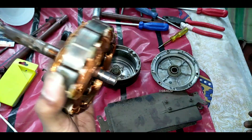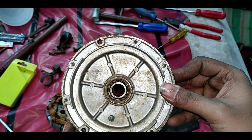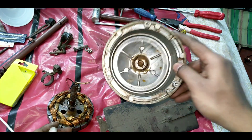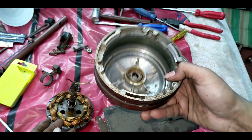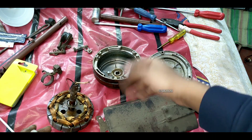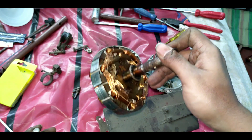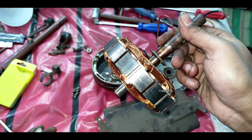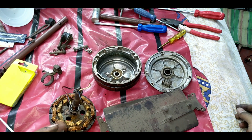This is an 8-pole winding, and the bearings are also somewhat greased previously. There is a bearing here — this is a 6201 probably. The motor looks very compact, same as the HS24 also. The laminations are very thick, so it can also drive a 42-inch fan if the windings are strong.